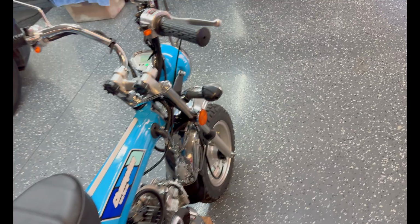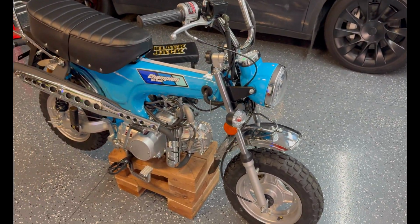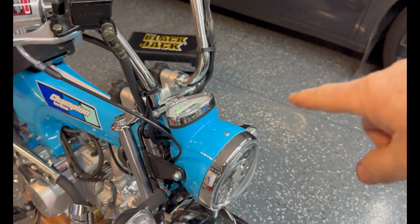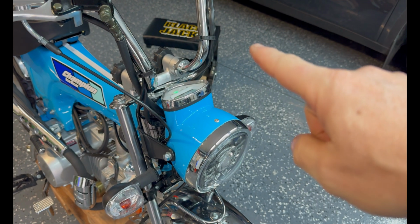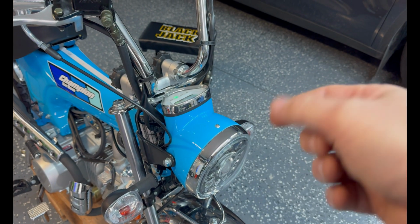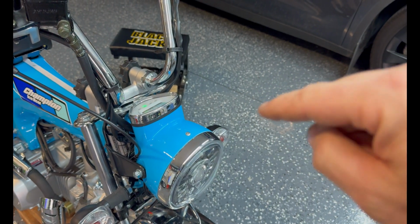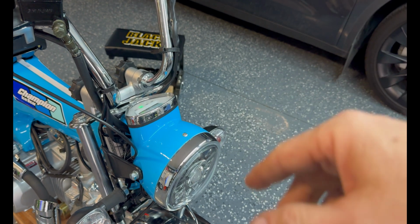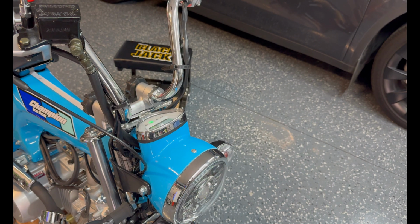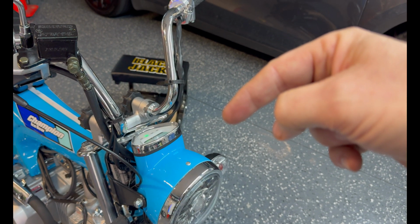The tail light and the headlight run off the dynamo, one of the yellow wires from the regulator rectifier. It's not an ideal setup, so there is a modification you can do. There is an orange wire in here, not the one from the turn signal, going to a black. You can create a short jumper that plugs in between those with butt or bullet connectors and have a third wire coming off. And you're going to pin that into the harness where the dynamo wire goes in. You're going to take that out, put in the orange tap.